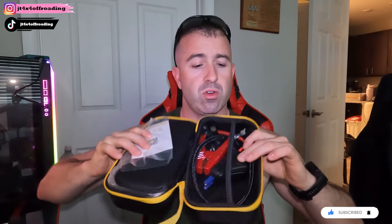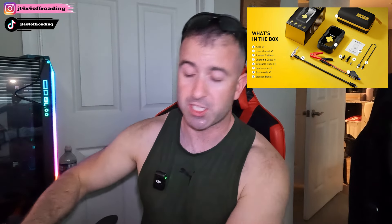Inside the box, here's what you're going to find — the jump starter clamps. I want to point something out because I don't know if anyone's used jump starters before. See that? Smart. Most jump starters are like this, but this one can actually get around the posts. They open up wide, which is important — on some Optima batteries, those posts are a little larger, and with clamps that barely open, you really have to wiggle around. These open up pretty wide and attach simply into the unit.